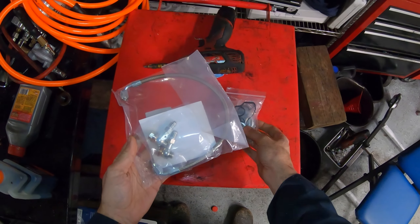Now if I pry on it here it should pop loose and make a big mess. I'll wait a little bit for the engine to finish draining its coolant — go take a coffee break or something. Pull down a little bit to get the turbo feed line out of the turbo. That'll allow the filter housing to rotate so I can get to the gasket. Working from the bottom, I'm going to use a pick tool to pry out the old gaskets.